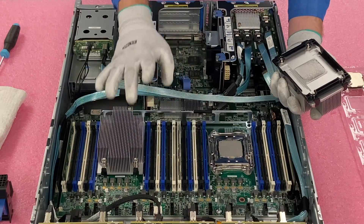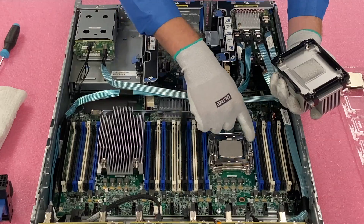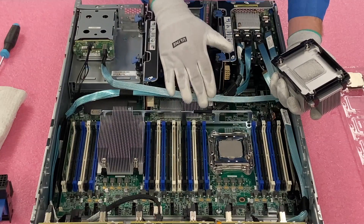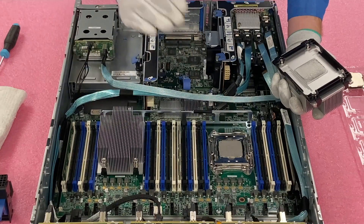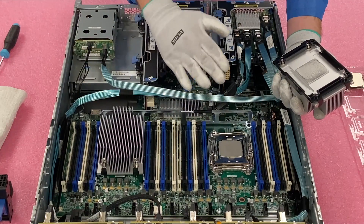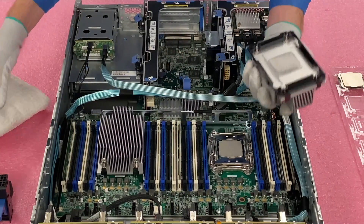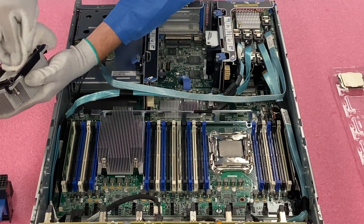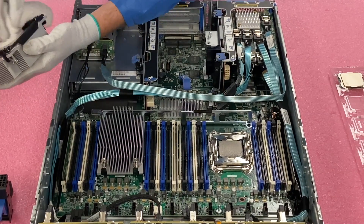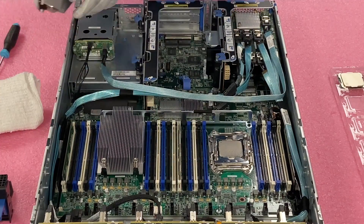Sometimes you'll get it when it's super old and flaky and there's thermal paste everywhere. If you're at home and you have it all over the outer casing and on the latches, definitely clean it up before you remove the CPU. What can end up happening is when you're pulling the CPU out, some of that stuff will flake in, and if one pin is off just a little bit it can just be disastrous. So I'm going to do a nice little wipe down with our rag and we're back to good — nice and clean.